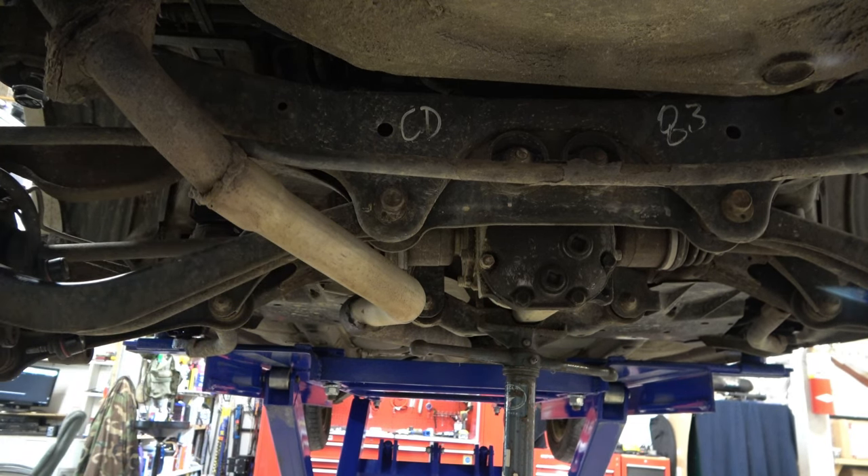It's really nice on this side — this car has an aftermarket exhaust system, so this muffler is missing, which made it a little easier to film this. The process is not difficult by any means, just a little stressful, especially if you're not a mechanic — you know, having all this stuff dangling over your head. Just be sure to really secure everything nicely. I'm going to go ahead and bolt that in there, do the same with the front, and we'll be ready to start reassembling. The original bolt has this very large washer on it — you are going to reuse that.